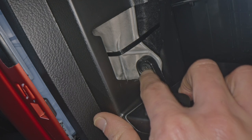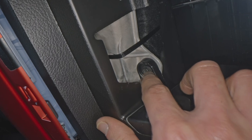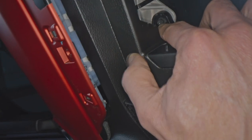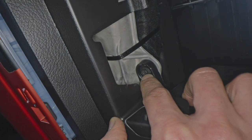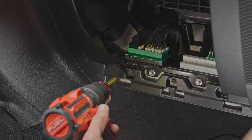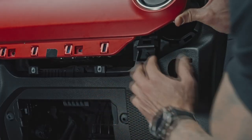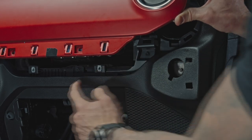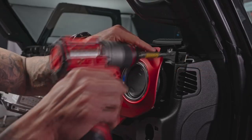To remove the speaker pod, there's a screw at the top holding it in. Go ahead and remove that one screw, which is on the top right side of the glove box when looking directly into it. Then remove these three screws in the bottom of the glove box. To remove the dash, there are three more screws on the front: one up top, one in the middle, and one up here — let's take the top screw out, then the middle one.